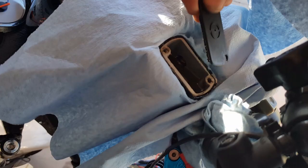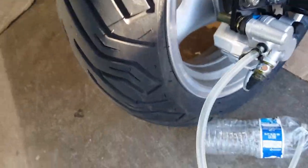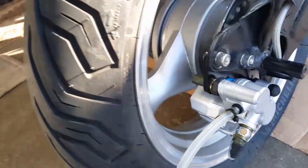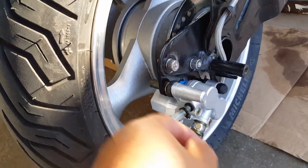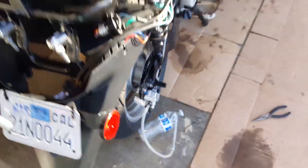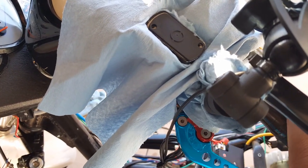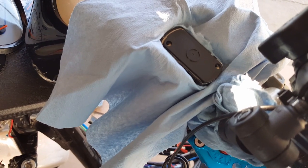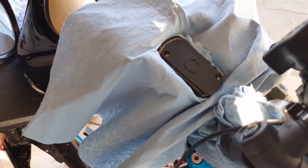All right, so here we go. I'm just going to put him over this right here. He's not going to go over. Then I'm just going to pump it, even though it's not broken open yet, meaning there's no ventilation coming in. Since you have this open, it doesn't mean it's exposed right now because the bleeder bolt is still sealed. You have to turn this counterclockwise to get the bleeder bolt to release fluid out. So even though it's not open yet, I'm going to siphon until I feel a bit more tension. It might not be until I actually crack it open. So what I'm doing is cranking it. You don't have to worry about the geyser, it's just spurting itself. I can do it as hard as I want. The geyser's not going to have that much force to squirt out the plastic.